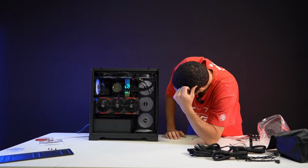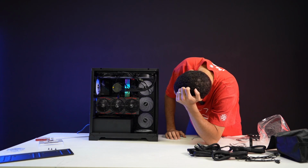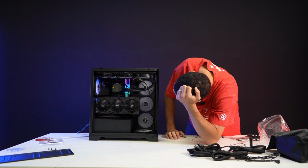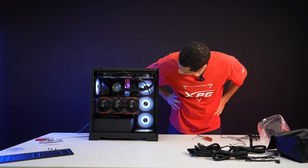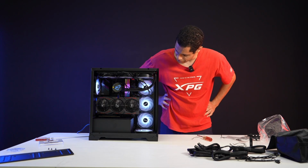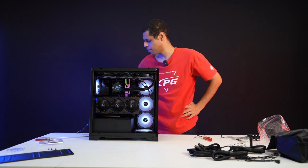Yeah, which is funny because it's working, and as you see, my ARGB is not working. Like I pinned that wrong, which is weird. All right, so let's turn it off. Oh, wait, no, my LEDs are working, but they're not giving me RGB though, because these are RGB fans, but I'm not getting RGB, so I must have pinned it wrong. Unless the motherboard, no, okay, well, let's turn it off.